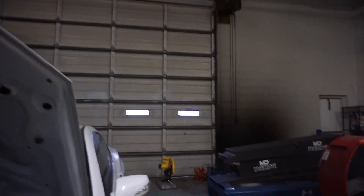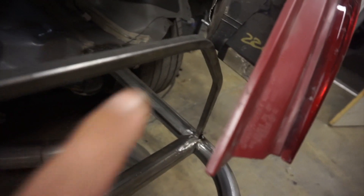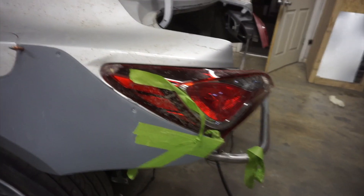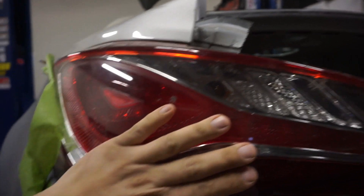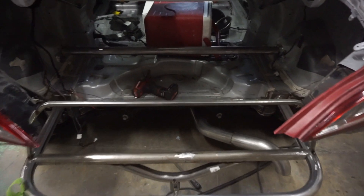Back in the shop — it's like 80 degrees out, pretty nice. What I did was take another little bar we picked up a while ago, and it's going to go right under the tail light. I bent it — about 45 degrees and another 20 degrees on each side. This side came out perfect, just needs the factory nuts. The other side was damaged before and is missing a bunch of metal, so I need to add extra metal there to support it and bring it up.